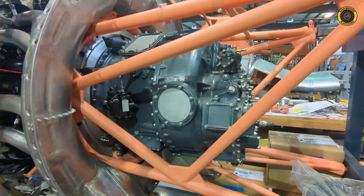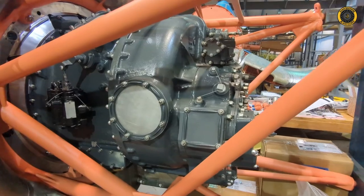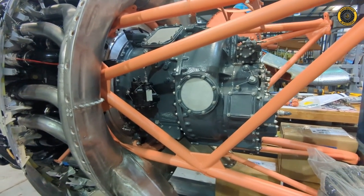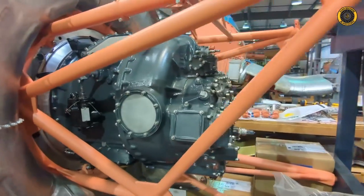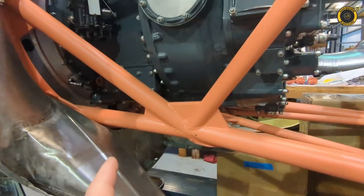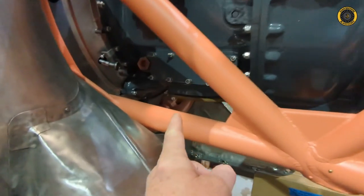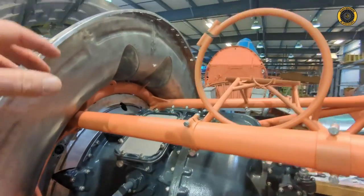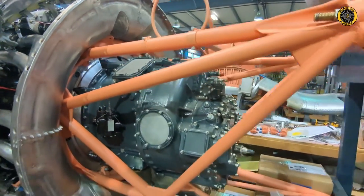The basic procedure is to come back on power a little bit as you're climbing out before you engage the next stage of blower, then come back on power and you've got instantly more manifold pressure thanks to this centrifugal flow compressor. It blows into a Bendix three-barreled pressure carburetor, which on this model is an updraft carburetor. On later model engines they spun the accessory case around and those carburetors were downdraft pressure carburetors.